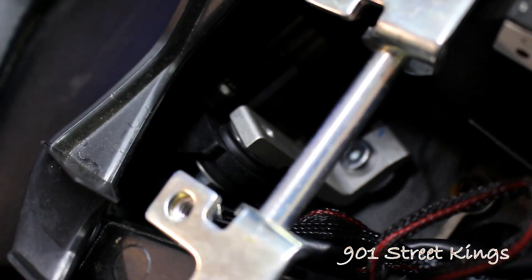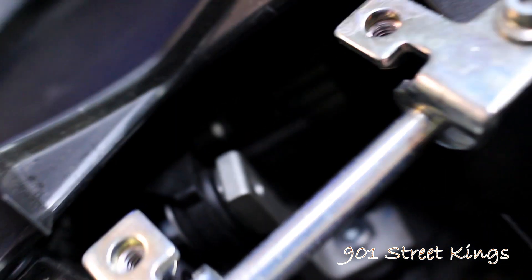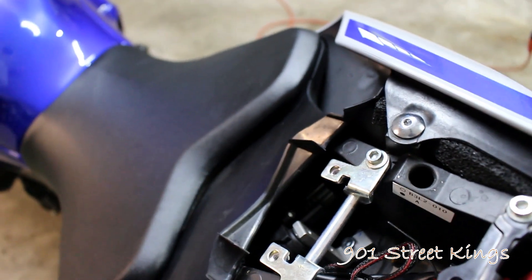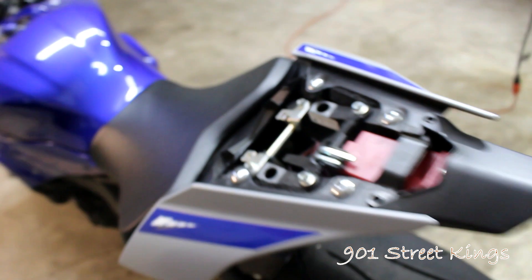If you look right in there, you see that bracket — it's got a gear on it. That gear has two little clips on it, exactly like these, for like a throttle cable or whatever. And those two cables are connected to that motor and it spins and operates the valve. That is the exit valve for a Yamaha. Very basic, very simple, and purely for sound and possibly some emissions benefits. I can see that recirculating around the cat or limiting the amount of exhaust that I have over time so that it will pass an emissions test. Performance-wise, zero.